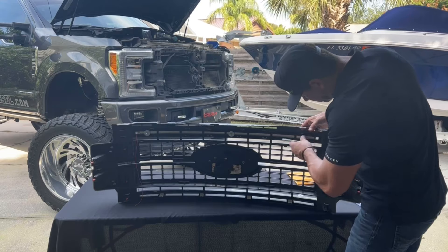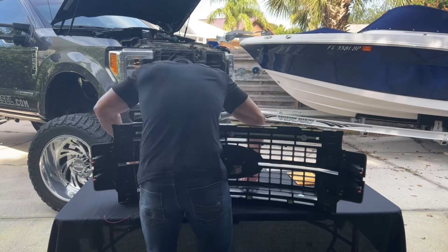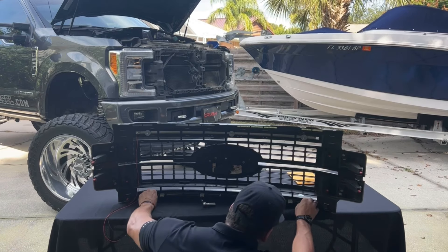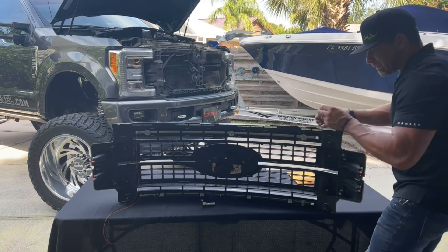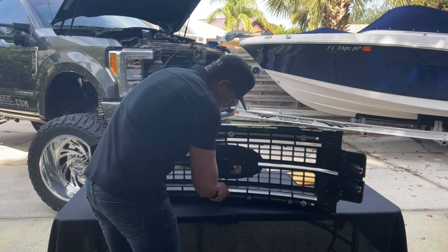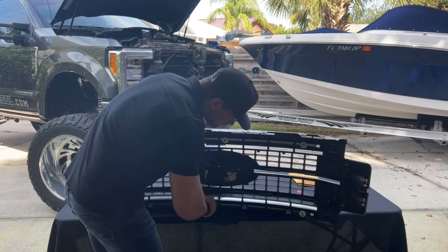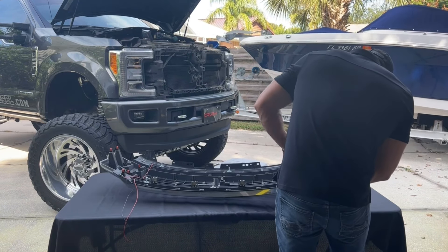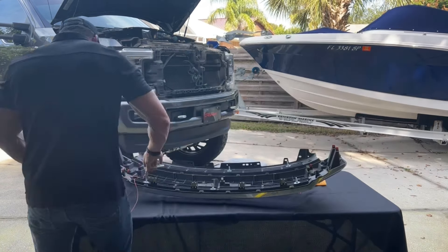Tighten the nuts just to where they take out the slack. You'll see me grab the washer to make sure they're not too tight — that's really all it takes, it doesn't take much. You have a chance of bending the aluminum with the light in it or pulling the stud out of the aluminum housing, and then you're screwed. Also, we're talking about shortening these studs — they seem a little long for some grills, so that's the next step. You don't want to run into any issues where they're hitting something on the truck.